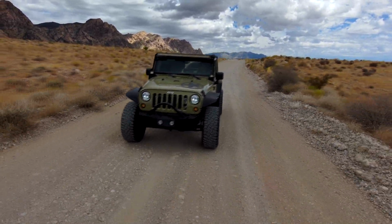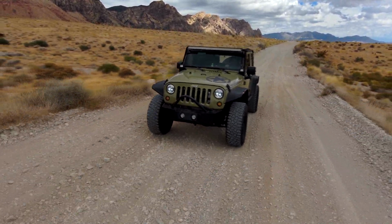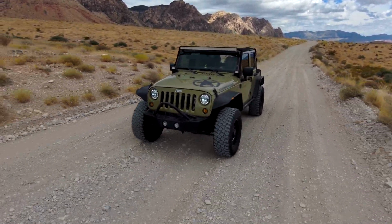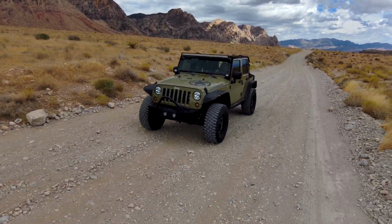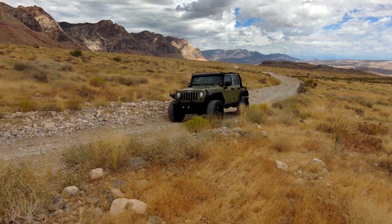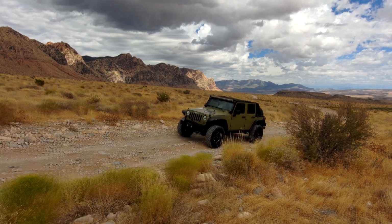If you have a Jeep on 32-inch tires and you're living in a relatively cool climate at low altitude, you're fine. But if you're towing a trailer in Colorado at 10,000 feet with a high compression V8 engine, you don't want to block that grill. So that's pretty obvious. Winches. Winch is fine. Sink it. Get a bumper that you're happy with, but make sure it sinks the winch. You don't want the winch really to stick up into the openings of the grill.